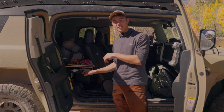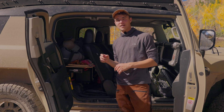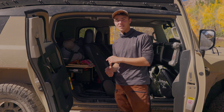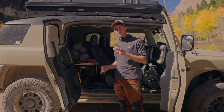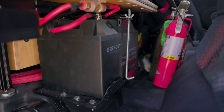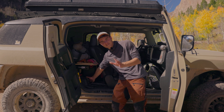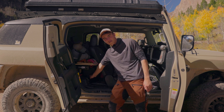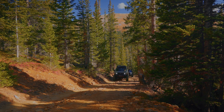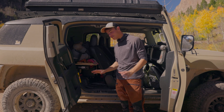The Bluetooth module plugged into the charger lets me open an app near the FJ to see battery percentage, charging status, and all the health data — it's insane how much data you get, and it's included in the bundle. The battery itself is mounted in a little battery tray hanging under the Air Down Gear Up system, with brackets bolted to the body and sealed. It's been stable the entire two-week trip — jostling around every day on rough terrain, the vehicle bouncing, but the battery stays steady. I have wires from the charger going to the battery with 40 amp fuses in between each part, just a little above the charger's 30 amp output.